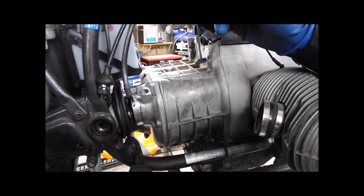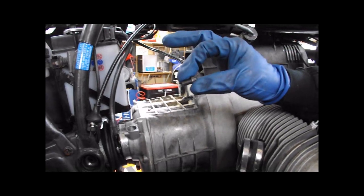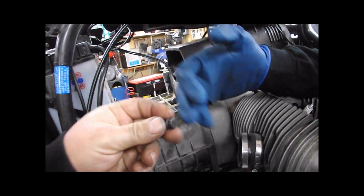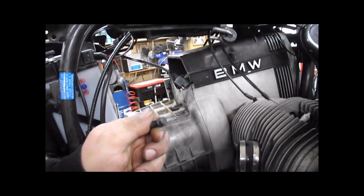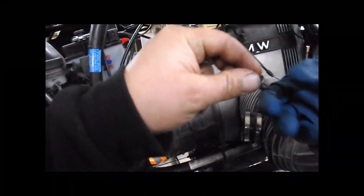At this point, you're ready to put the drive shaft bolts in. Use new drive shaft bolts. If you use the ones that end with part number 297, you do not need the lock washers. You don't need anything. Torque them to at least 32 Newton meters, which we'll outline as soon as Sean gets these in. Don't forget your clamp.